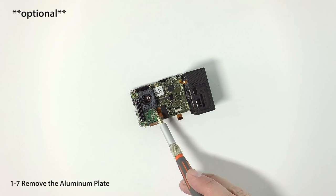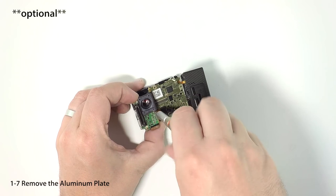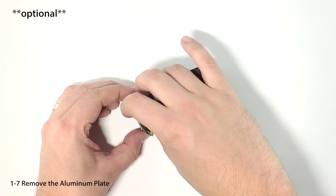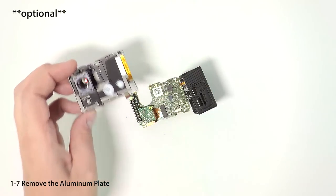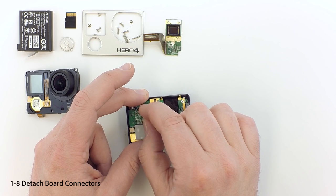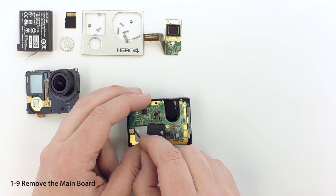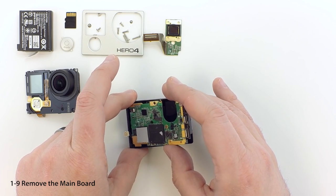In some cases the board can be difficult to remove. If that's the case, you can remove the screws from the I-O board and angle the board slightly so there's more room to remove the main circuit board. Make sure you replace the screws once the board is free. Remove the tape covering the ribbon connector on the upper left and flip up the locking tab. In some cases this ribbon may have already come free. Pop off the light-colored plastic connector by gently pulling up on the right edge with your screwdriver, then gently pull out the main board assembly to remove it from the housing.